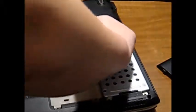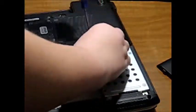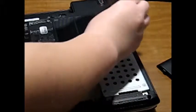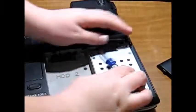Only take out the screws that are farthest up or farthest down. The ones in the middle are part of the metal shield — don't take those out or you'll take apart your whole hard drive, which you can do once you've removed the hard drive.